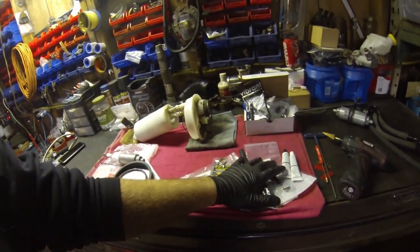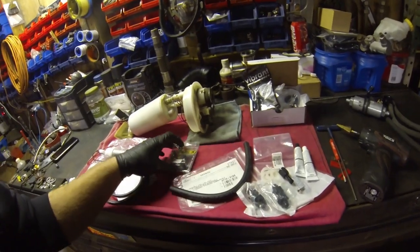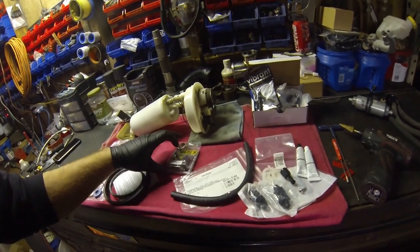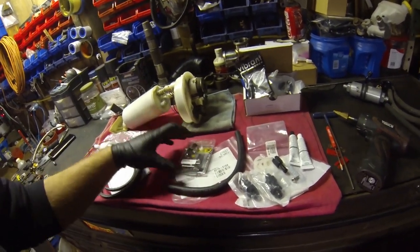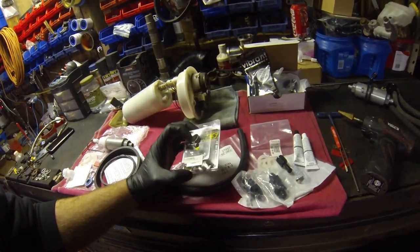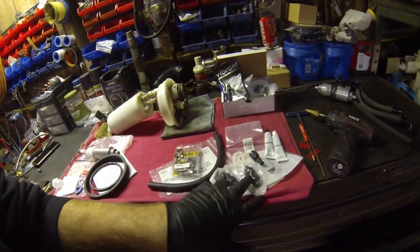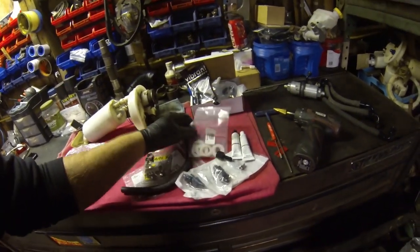These are parts to do the bottleneck fix. So this is a Gates submersible fuel line. It is alcohol rated. Part number is 27097. You can search that right on Amazon. I think it's like $19 shipped to the house. I'm also using Earl's stainless banded style hose clamps for the line inside, two Summit bottleneck, or bulkhead adapters, sorry.